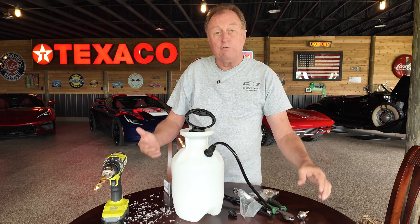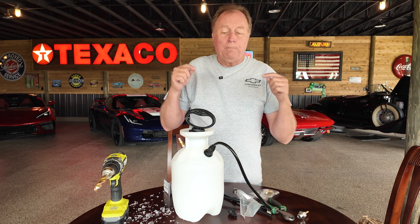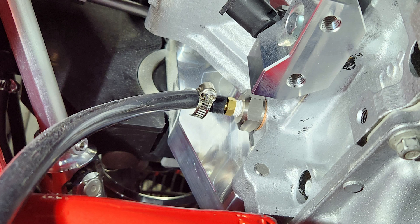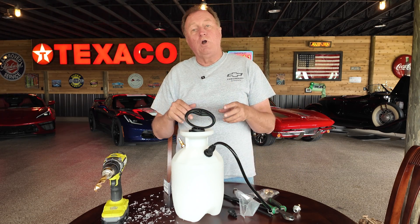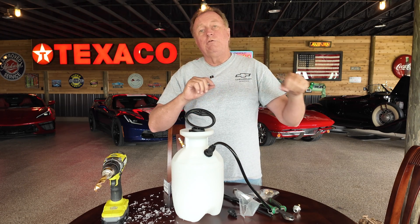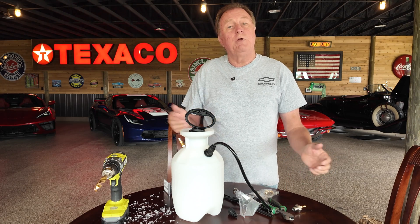That's as simple as it gets to making the kit. We built this whole thing in about 10 minutes and for less than $50. I will also have a picture here on where in the block this will actually screw into. There will be another process video out there on the internet on exactly how to prime the engine. I'm going to put the oil in, start priming it, and periodically turn the engine crankshaft 90 degrees, continuing until I get about four quarts of oil in the system. Then I'll check the oil level, take my valve off, plug it up, and I should be ready to fire the engine.